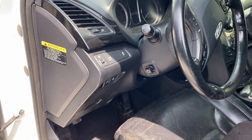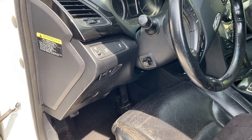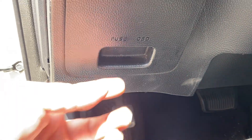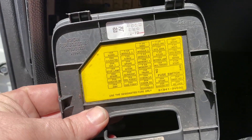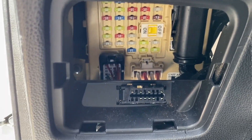There are two main fuse boxes for a 2013 Hyundai Azera. The first one is located on the driver's side of the dash. There'll be a cover here that you need to remove by pulling out on it. The back side of this cover will have the fuse positions labeled. Behind that cover you'll see the fuses.